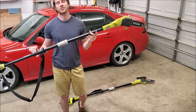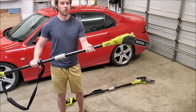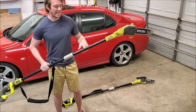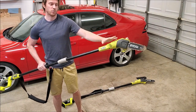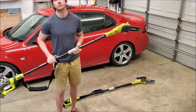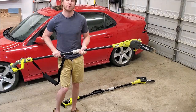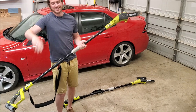I do probably need to adjust the chain a little bit and I certainly need to fill it up with oil, but that just goes to show you: if you have a broken tool, don't necessarily throw it out. Take a little bit of time, some basic tools, and a little bit of knowledge, tear it apart and see what's going on. If you have an extended warranty on your Ryobi tool you may be able to just turn it in for a refund or exchange. But for me, I bought it used. You can actually replace that blown fuse - a little disclaimer, you probably should replace it with another fuse as bypassing it may cause more motor issues long-term, but at least now I have a working pole saw. If this video helped you out give it a thumbs up, drop a comment below, and consider subscribing!